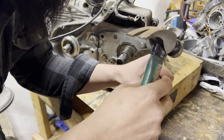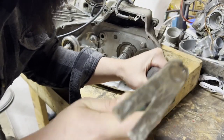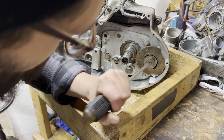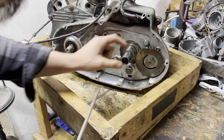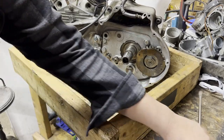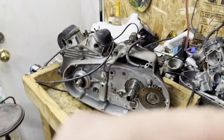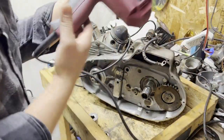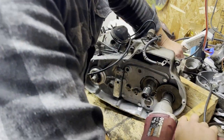We've got the folded-over lock washers — you do not want to use a screwdriver this big typically. These are free to rotate. One, two — those are free. Now I'll put the impact on here and rip that off. If you have air tools, this is one of those situations you'll want an actual big impact. I don't have one here, so we will use an electric impact.